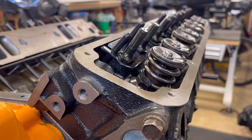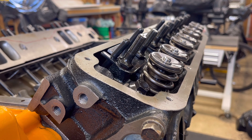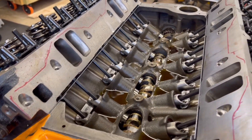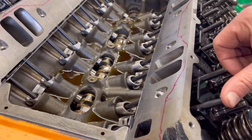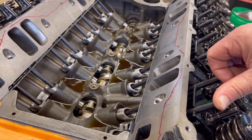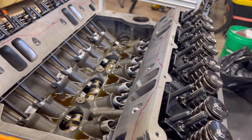There are multiple ways on how to do this. I do what's considered the base circle of the cam method. If you look at your camshaft here, you have your lobes. What you want to do is make sure that your lifter is on the base circle. I rotate the engine and push down on this lightly. When it's all the way down and stops moving, you're on the base circle — which is the bottom of the camshaft, the shortest and most relaxed part of it.